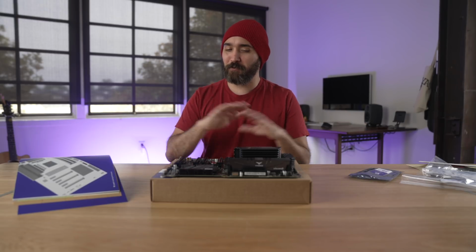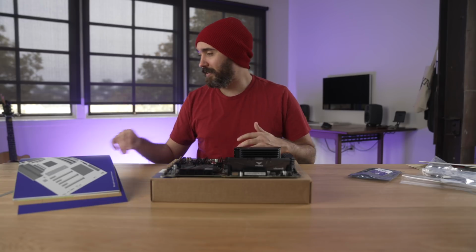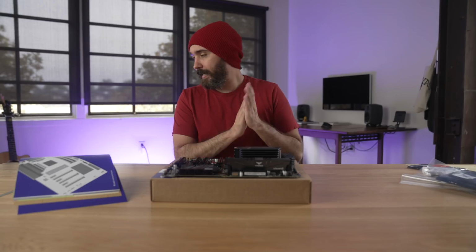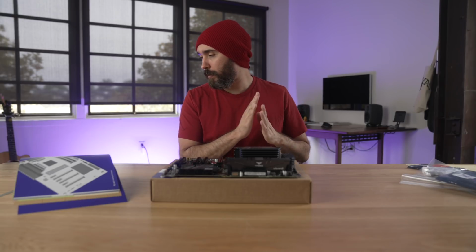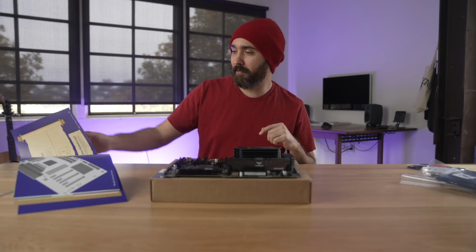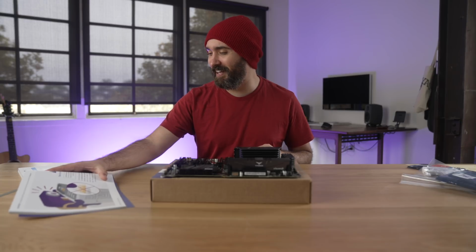So it's sort of a, once you've done all the other steps, if it's still not working, here's what to maybe double check. So we're down 1 level onto level 2. Installing the processor. Careful on this step. The pins in the CPU or motherboard are easily bent, and if they're damaged, they may not work properly. Great, no stress. Oh yeah, they give you multiple pages of warning on this.